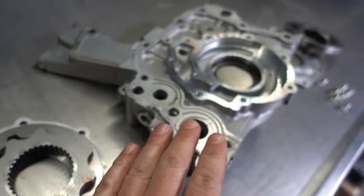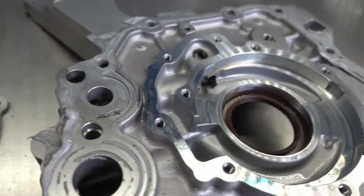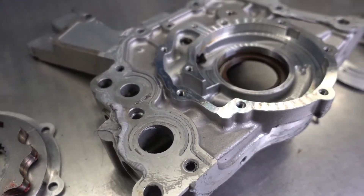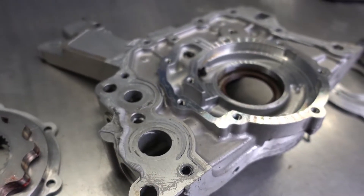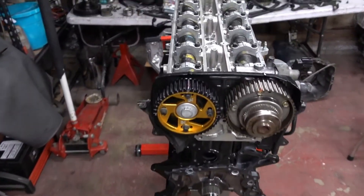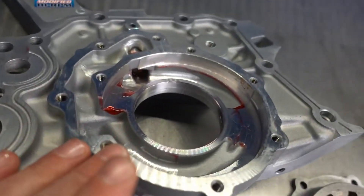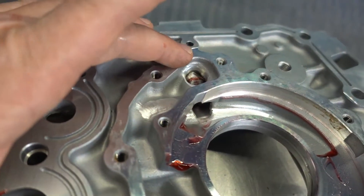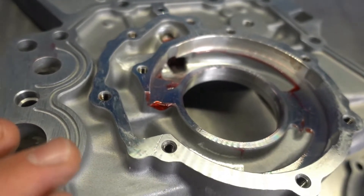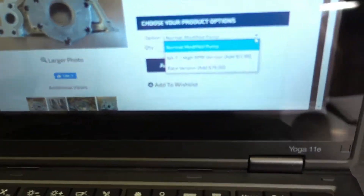This stock pump is great for stock RPMs, which is like 6,700 RPMs. I've heard of guys using this up to 8,000 RPMs and they're okay, but we don't know the longevity and we really don't know what kind of damage they're doing on the long run to their engines. If you're running a stock engine, you're probably okay — you're gonna have to rebuild it eventually anyway. But if you're running a fully built modified engine like me, that you have a lot of money invested in, you don't want to take that risk. You don't want to use a stock pump. Go with the modified one, get the relief valve ported this way — that way you know for sure when you're revving the RPMs up you're not over-pressurizing the engine and everything's flowing a lot better.